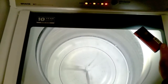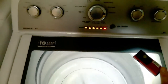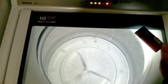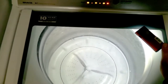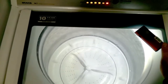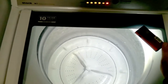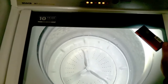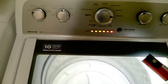At this point we just let it do its thing. If you're doing this calibration because you have too much water filling up at one time — like if you put a sock in and it fills all the way up — that could be the calibration, or it could also be a main control board issue or your actuator, which has a sensor that senses the weight of the tub. This is a good step to take before putting money into the machine.